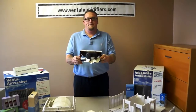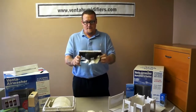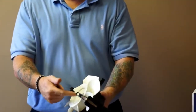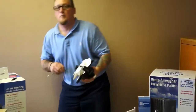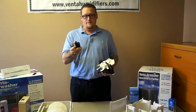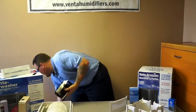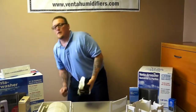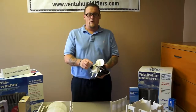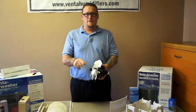This is how your replacement motor will come if it's a Plus unit: it'll come with a fan but no gear, no mounting ring or coupling, and no power cord — so if you have a Plus unit, please save your power cord. For classic units, the power cord is attached, so it's one assembly, and it will come to you without the mounting ring, coupling, or gear.